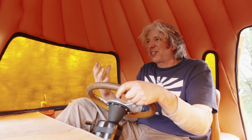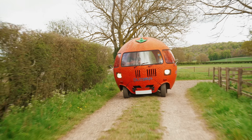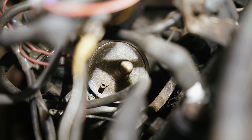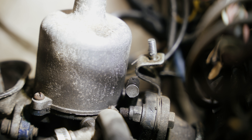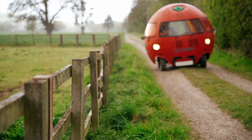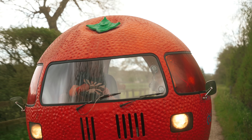Also, it's a bit stuttery — not really getting up and going. I noticed earlier while I was playing around with the spark leads that there's a vacuum hose missing off the distributor. I wasn't sure whether somebody had been fiddling and come up with a proper setting, but it was blanked off just by the carburettor. I think the fact that we haven't got the vacuum connected means we no longer have vacuum advance, which is perhaps why it's bogging down. Basically trying to give it a bit of acceleration — not much is going on. So that's another job for the list.